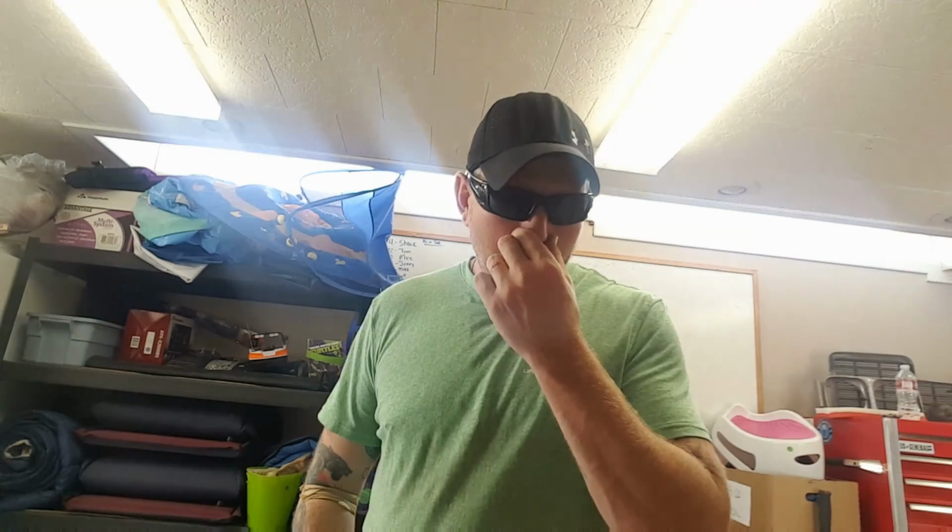You start that thing up, it starts up every time. Sorry, I'm pissed off right now. I'm going to have a little bit of cuss words coming at you. It fires up right away. It idles. It doesn't die. In fact, it idles better sitting than it does when you have it in drive and you're just coasting along. When you're doing that, it's almost wanting to die. So the idle is too low.